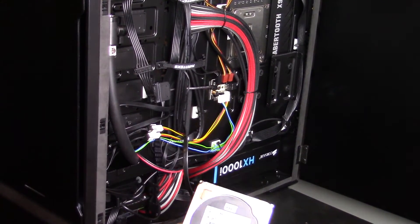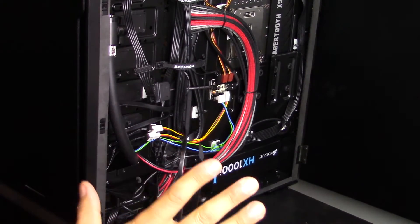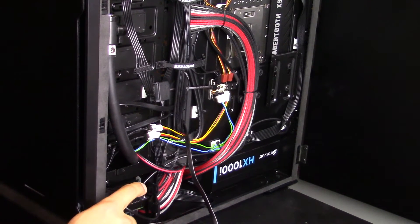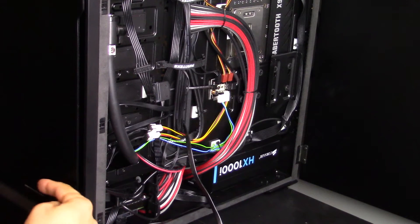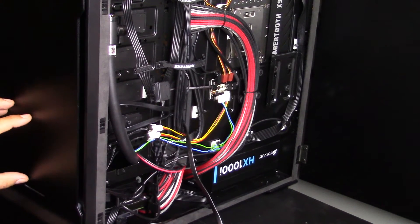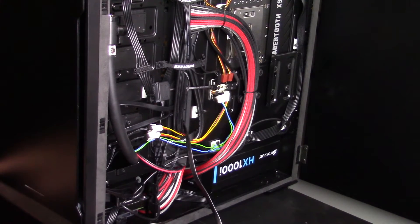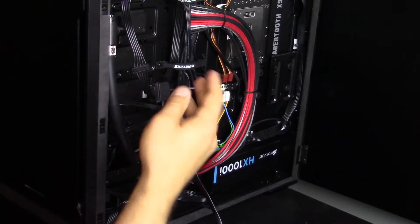We're running into a little bit of a snag. I have the hard drive here and the SATA data cable, which I've snaked through the grommet and connected to the motherboard off camera — it took a while to maneuver around all the tubing and cables. But I'm having a problem with power. The SATA power cable that powers the existing hard drive runs from the power supply and then snakes toward the front of the case because there's an SSD mounted to the front of the basement on that side. So I don't have any available power connections except for some up top that are all zip-tied in place.